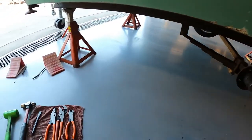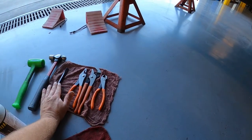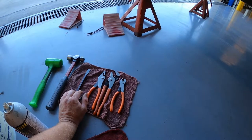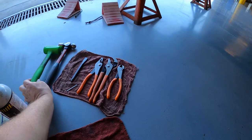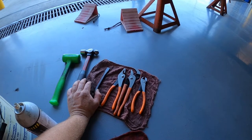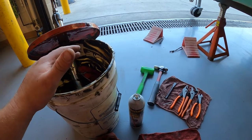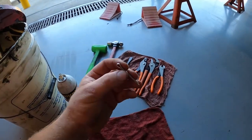Tool-wise, you don't need a whole ton. We're just going to need a couple pliers and hand tools, a chisel - mainly to get the cap off if you don't have a bearing cap remover - then a couple hammers: one for the chisel and one non-marring hammer so we don't damage the cap or the back seal. Parts-wise, we just need high temp wheel bearing grease, some brake clean, and a new cotter pin.